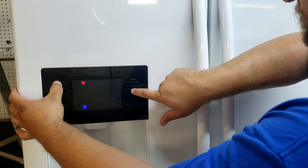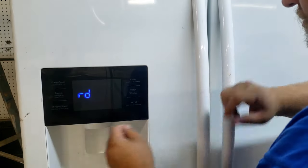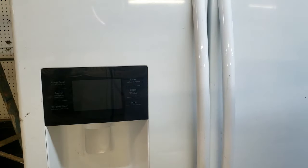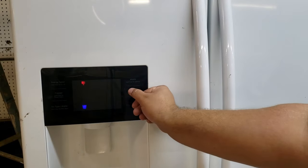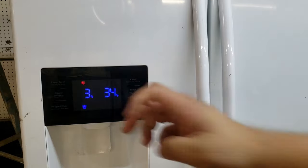It returned to what mode was currently running, which was the forced defrost mode on the refrigerator. To quit the forced mode entirely and end the cycles and return the refrigerator to its normal operating mode, you will select the screen option that is totally blank after the FD code or FD mode and wait for about 8 seconds. The beeping will stop and the refrigerator will return to its normal mode of operations.